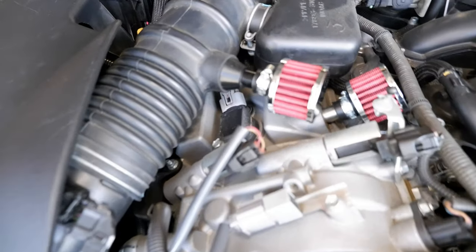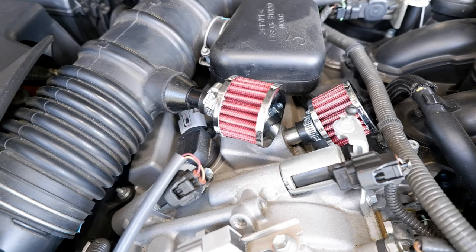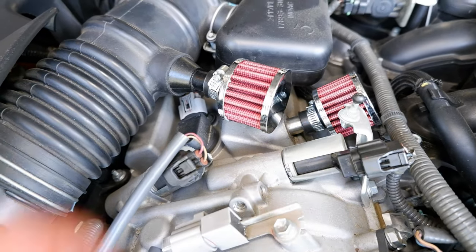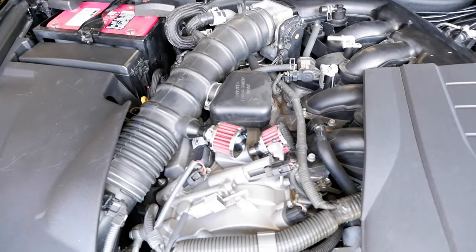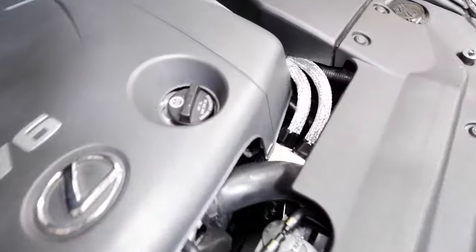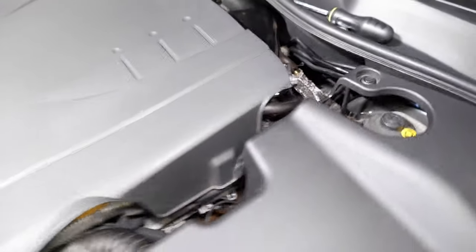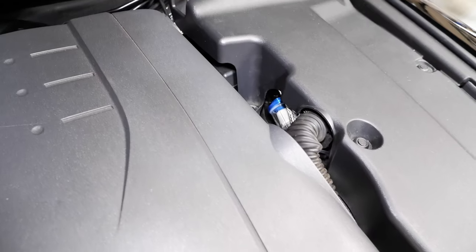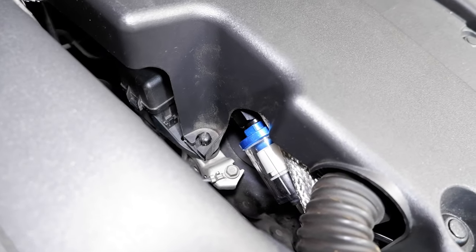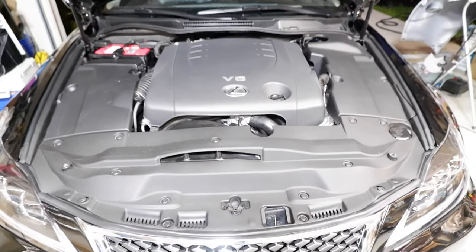I got those two breather filters installed. Since I couldn't find the exact size of the nozzle I had to order ones slightly smaller and squeezed them in there. They're holding pretty well - I've got them past the nipple and clamped down so they're going to hold. I test fitted the cover and it fits. With all the panels back on it hides pretty much everything down here. You can see the steel braided hose coming out of the side and a little bit up top but overall it looks pretty clean. Nice install. I've got the inline filter in just the right spot to see it during maintenance to check if I'm collecting any oil up there.